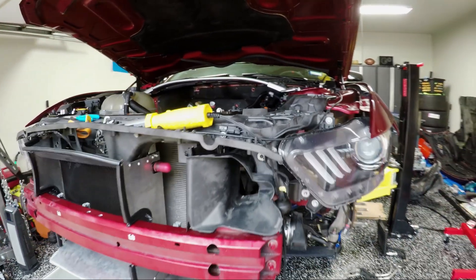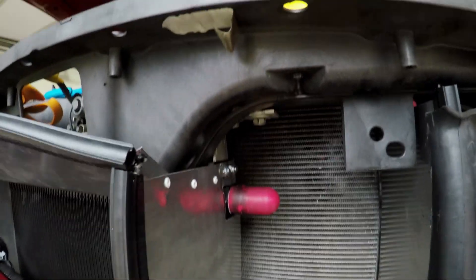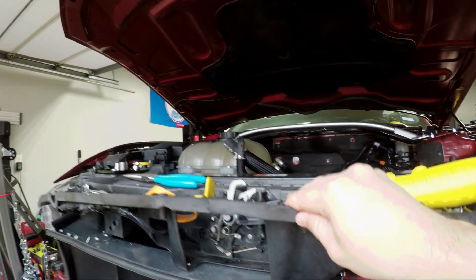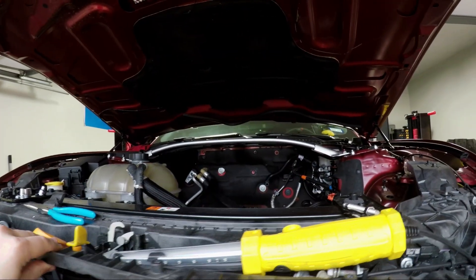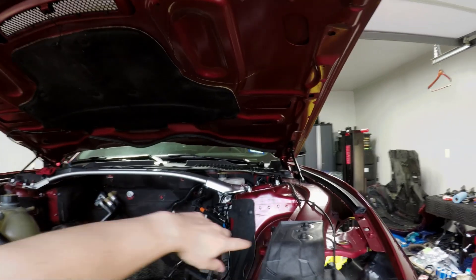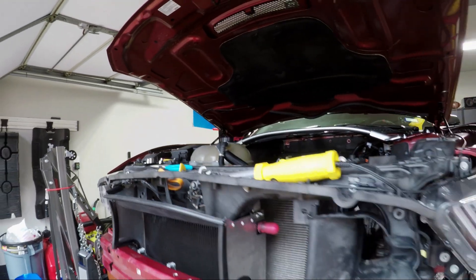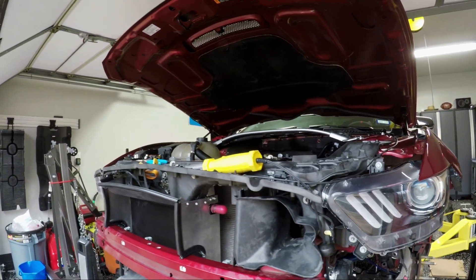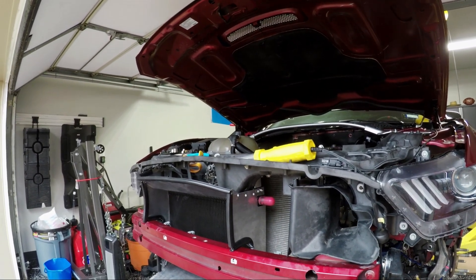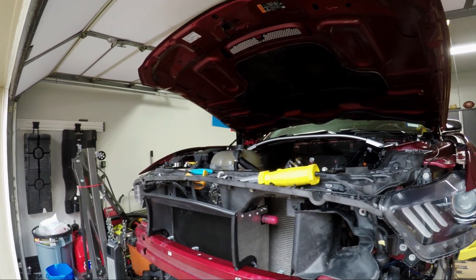We're going to do quick latch hood pins here on the hood for a little bit more stability, especially since the OEM setup had supports that ran from here to back behind this bar — those added additional support to an area that's obviously going to see a lot of stress holding down the hood. The hood pins will bolt in here and add stability to the hood and reduce the stress on the front. Look for those videos coming in the near future. If you have any questions about this ducting or anything like that, feel free to drop me a question — I'm happy to chat. Until the next video, see you guys later.